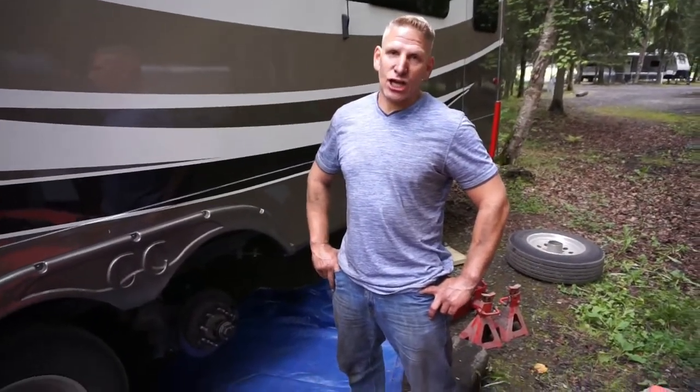Thanks for watching, and that was my experience with replacing a spring bushing, spring hanger, I don't know what you want to call it. It's a big rubber bushing that functions as part of the spring on a MorRyde Independent Suspension. It definitely should make a big difference. We'll see once we have to move this and hook up. We should not have our lean. We were leaning a couple inches to the side.